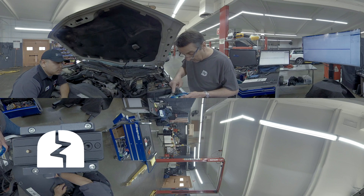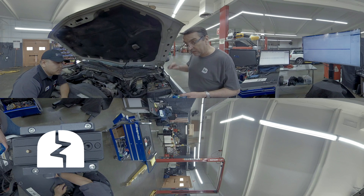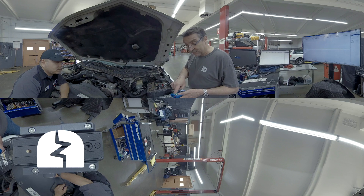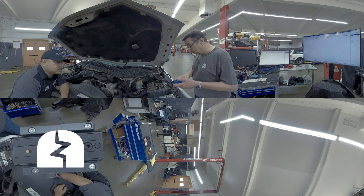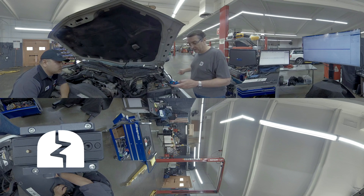So what this means is we just validated we have B-plus power to one side and we have ground completed through the pump. So if this light was not on, we would need to check and make sure we have power on the plus side. If we had power on the plus side and the light wasn't on, we have an open circuit between here and the tank. You could have a connection problem — you could hang this thing down, go back there and start wiggling, touching, maybe tap the tank. If the light started to flip on, you know you've got a problem back there.